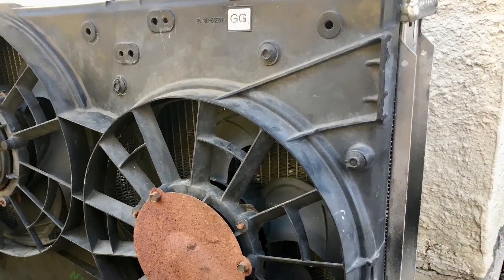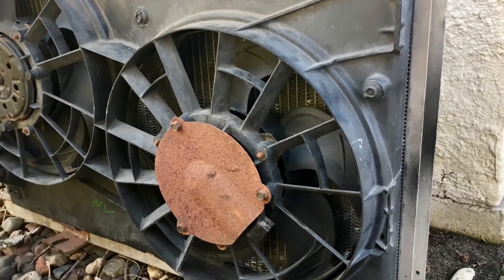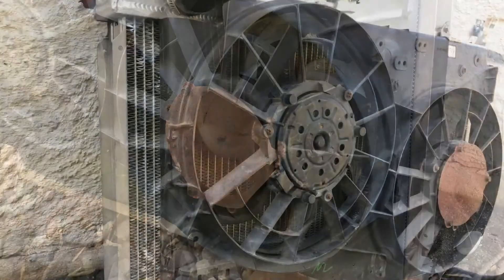Here's a look at it on my 240SX radiator. You can see it's almost the perfect height and is only slightly narrower than the radiator core. I have the cross flow style, so I needed to make a little notch in the corner, but if you had a radiator with the inlet and outlet on the same side, you probably would not need to modify it at all.